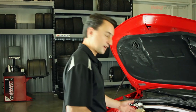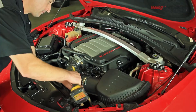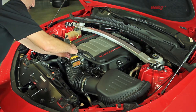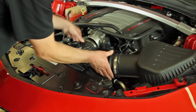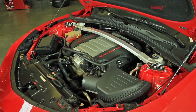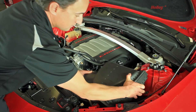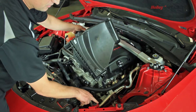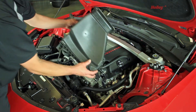Next, we're going to remove the hose clamps so we can get the elbow and the intake box out of the way. Pull it off the throttle body, pull it off the intake box, put that aside, and now your air box will just come out by pulling on it. Now there are three grommets located in here that you need to make sure aren't stuck on here, because we're going to use them with the new intake.